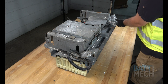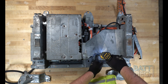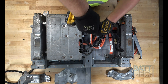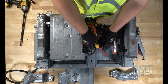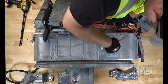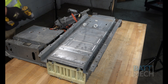After you've safely flipped the battery over, you'll remove the metal brackets and metal cover as shown here. Your goal now is to remove any nuts or bolts that hold these battery components to the bottom of the battery case. Once the components are detached, slide the components away from the bottom of the metal case. Next, you'll remove the screws that attach the bottom metal case to the battery modules.